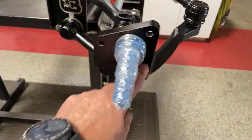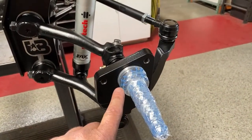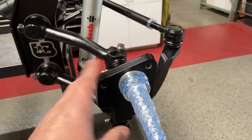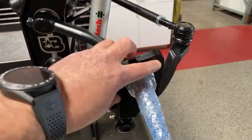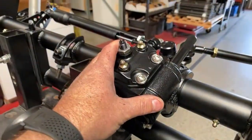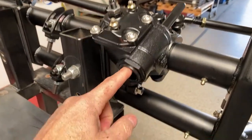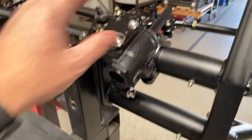We chase all the threads so you have proper application — whether a caliper bracket or backing plate — you don't have powder coat and debris inside the threads. We get it all nice and clean. Also, pro-built steering box with Zerk stainless fasteners. We adjust the thrust here to get the right feel within the steering column.